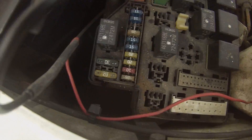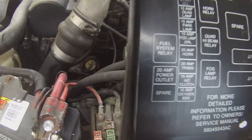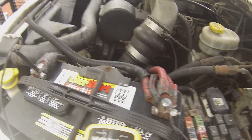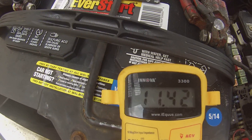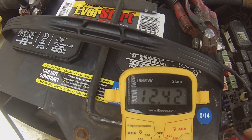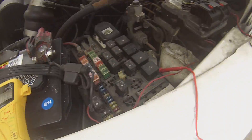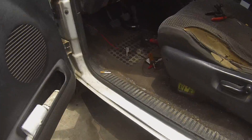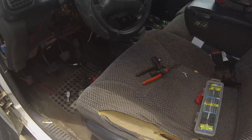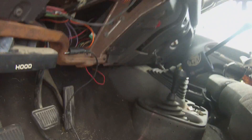I've got two little fuses here. If you look in the back of your panel, one says power outlet and one says spare. I'm thinking winner winner - but there's power with the key off. So that's a no-go. What I was going to do is put a toggle switch in, and I was talking to a buddy of mine about it and he about had a fit because I generally don't jerry-rig stuff - I try to do it legitimate.